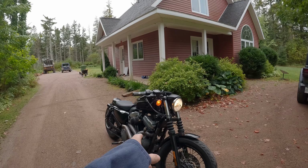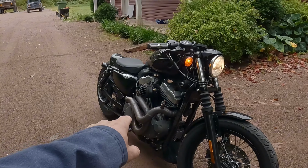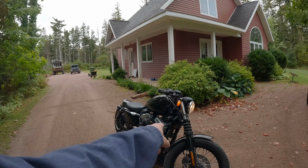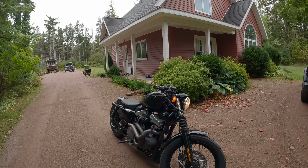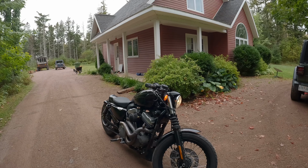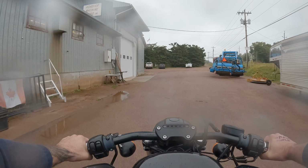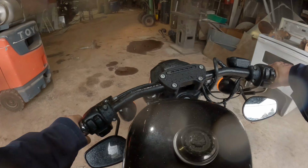Thing and get the header welded on, and it's got a kinetic pipe on it, and you can see where they do the bends on them. They do them with all pie cuts, and they've been breaking ever since I bought it. We welded all those pie cuts, and I've got another one starting to crack. We're going to go for a drive here this weekend, so I'm going to get some weld put on that, and hopefully it'll stay together for the weekend at least. Be a wet ride home.